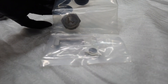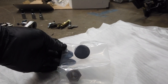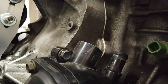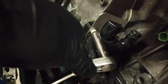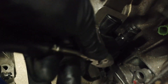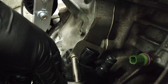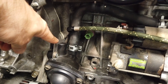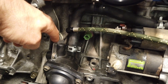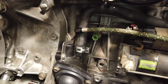So stay tuned. Next thing I did was use a kit from Hybrid Racing. Generally there'd be a hard line coming out of this neck right here, and since we don't have heat in this vehicle, we opted to go with this little kit that Hybrid Racing provides — with a plug here and then this little bracket to hold the plug down. The plug has a little o-ring on it, so it makes life real easy. You just pop it into place, it seals, you put this bracket on, and you've eliminated that water line.